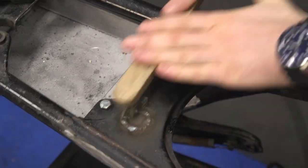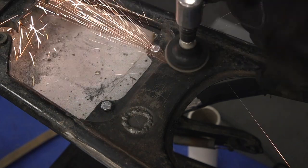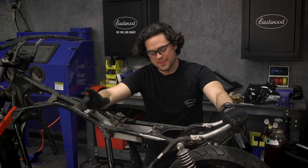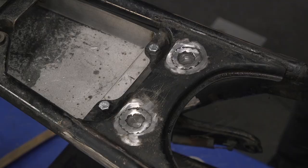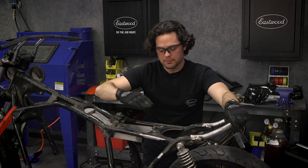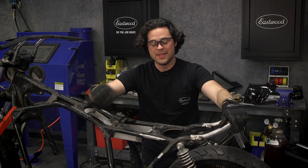Now, we had our plug welded in, went ahead and cleaned it up with a wire brush, and then ground down the welds. These don't need to be too pretty, but I wanted to make sure our seat pan was going to clear over top. I think these turned out pretty good — not the prettiest-looking welds ever, but that area was recessed a little bit. I think I'm going to come back later and just fill that in, blend it real nice, make it nice and smooth — but you're just going to have to keep watching. For 15 minutes of work, the plug kit really helped us out here, made this a quick job without messing around with cutting any metal.